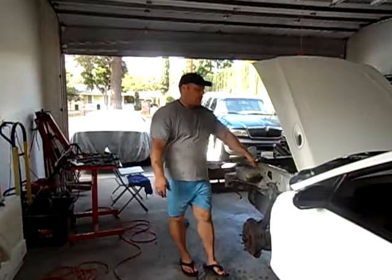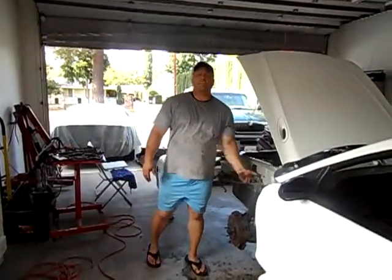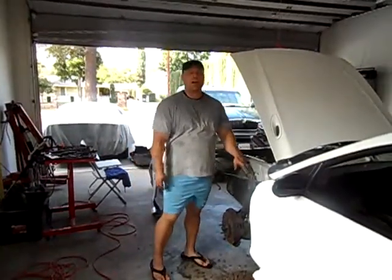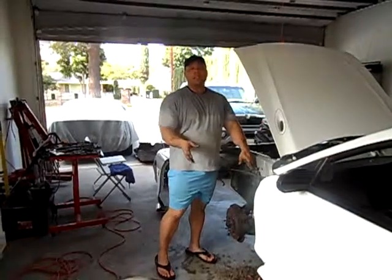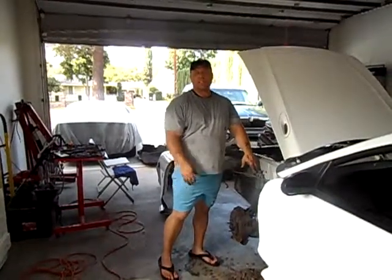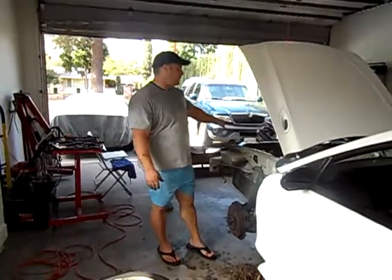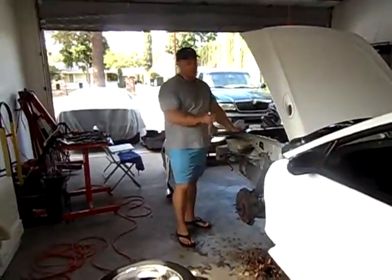But you have to take it down to where the fenders are off if you want access to every bit of wiring harness. I'm going to swap the entire wiring harness because I don't want to have to replug or repin any of the connectors, and since I have a full-fledged donor car, it just makes the process a little easier. Once all the electrical is out, I'm going to power wash it down just to really clean it up.